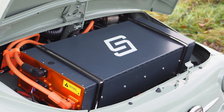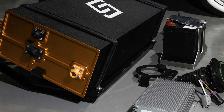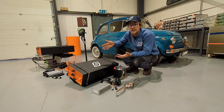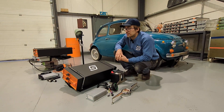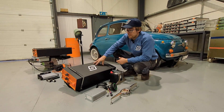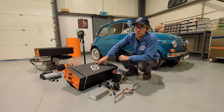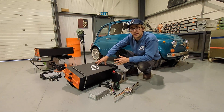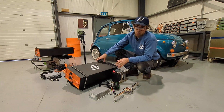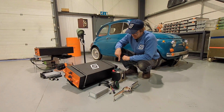This front battery box is pretty much the same as the rear. In total, front and rear, we've got 21 kilowatt hours, which is roughly a 120 mile range. If you want a boot, we can use one module in the front which gives you a bit of boot space, but you will sacrifice range — talking about 70-ish mile range with one module in the front, two in the rear. Most people opt for two, but the choice is yours.